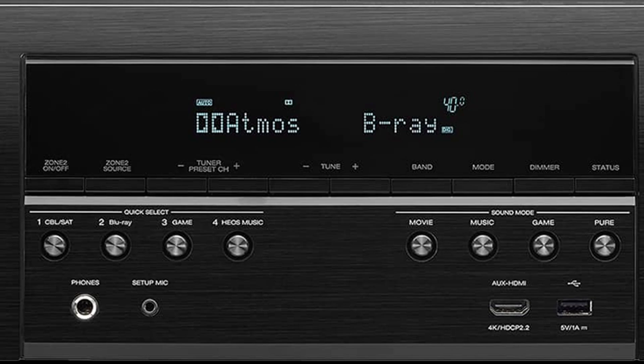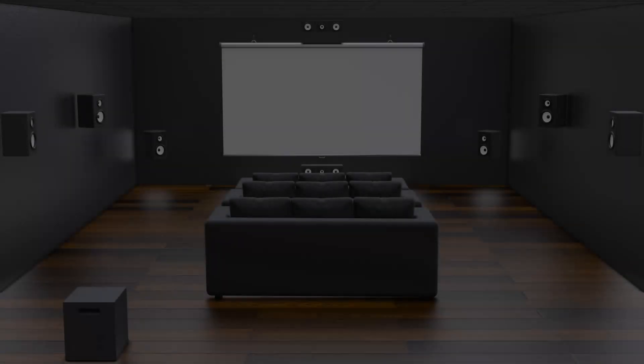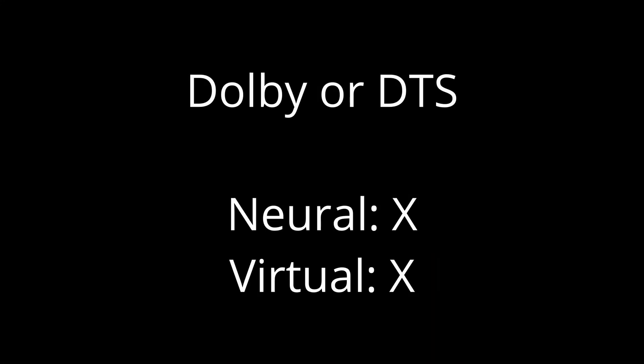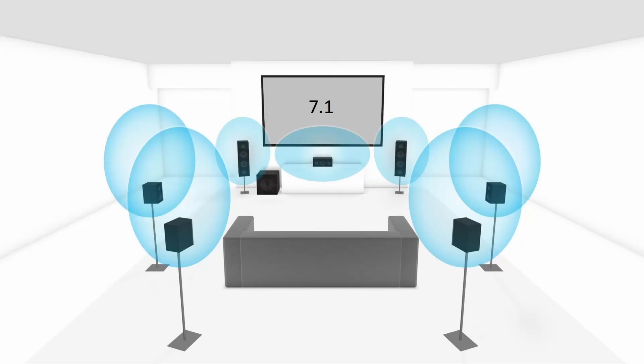So the question is: why would you need to select any other mode? This all comes down to preferences and to take advantage of upscaling. If you start by selecting the pure mode for a 5.1 surround sound source — a movie, DVD — but then you would like to have the sound reach further behind you as in a 7.1 setup, or to give you more sound height, for newer receivers you simply would select Dolby or DTS Neural X or Virtual X. Or for older surround sound receivers you can select Dolby ProLogic 2 and DTS Neo 6. In these sound modes the receiver will break up the channels to expand the sound to other available speakers.